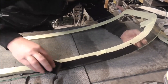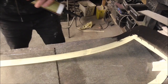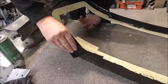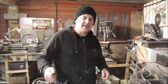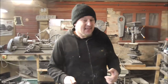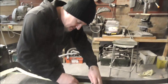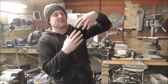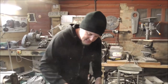Try not to get it too thick up to the edge, because when you pull the masking off it will make a ridge around the edge. So that's tidied around the edge. I'm not too worried about the other side of the glass because I'll be able to flip it over and with a Stanley knife blade get any little bits off. Never just leave this and think 'I'll remove the masking when it's dry' - you'll never get the masking off. Take the masking off when it's wet. I always try to pull up and across - if you get any of that stringy silicone like cheese on a pizza, it will fall back onto the silicone and not onto the clean glass.